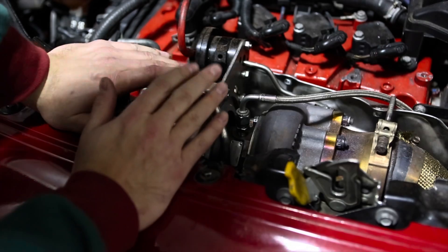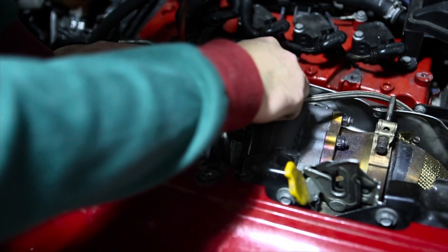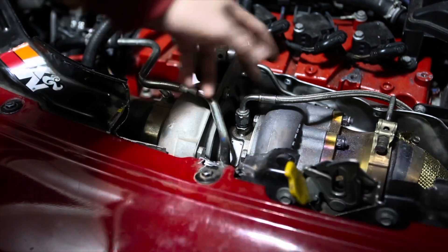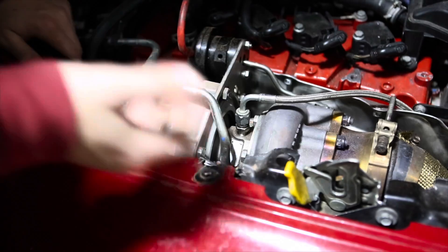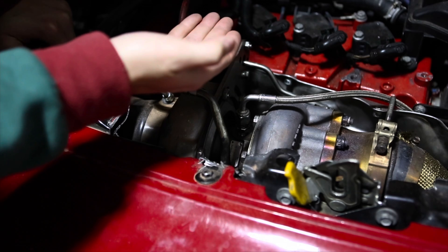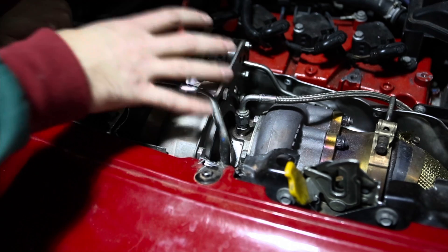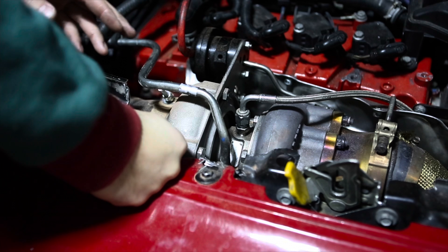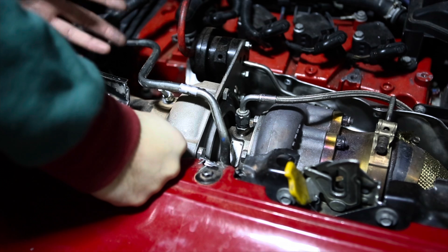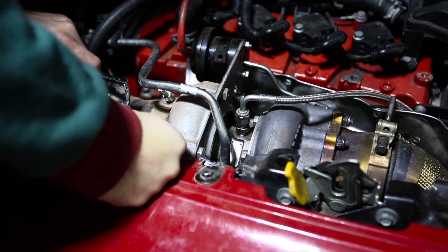For this front coolant line, there's nothing that had to be modified. For the rear coolant line, which sits on the back of the turbo housing — right here on the back — that line had to be cut because this comes up about a half an inch upwards. So the factory line just couldn't fit there. We had to do a little cutting which will be fixed — we just ordered some high quality, high temperature line that will be able to fit in there. And then after that, what we're going to do is steel braided if that doesn't work for now.